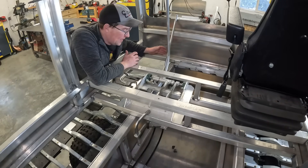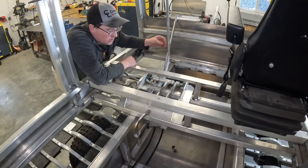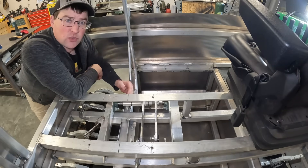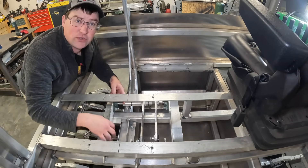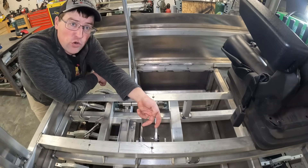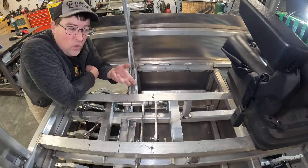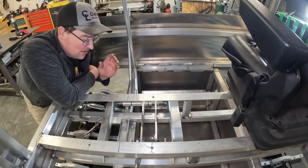I want to address one of the comments I kept getting — why didn't I just put the cables to each control lever directly and not go through a shaft? Perhaps I didn't show the camera angle well enough, but the center of the seat was right here. These levers have about a two-inch distance between them centered on the seat — you can't get control cables back there, that's outside of the vehicle. So both control levers needed to be moved over by six inches just to be able to put it together and have it work nicely. The only way I could think of to send motion in the same direction in one type of shaft was to have the inner shaft rotate and then an outer sleeve, and I still think that is the right thing to do.